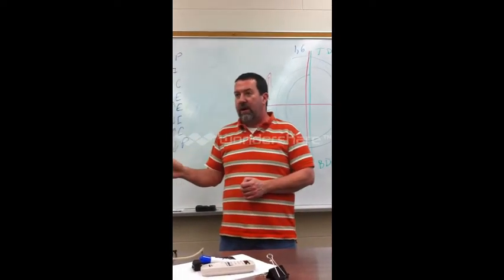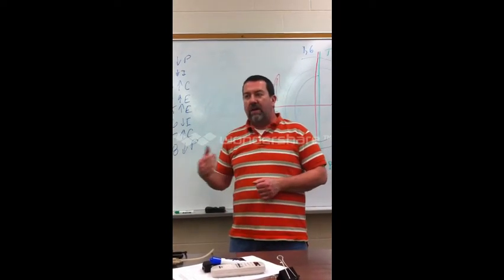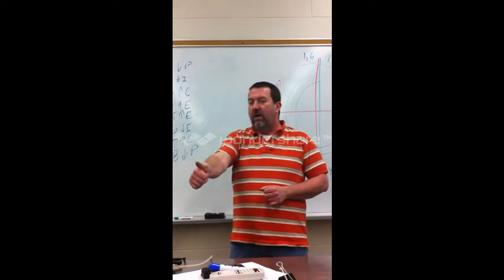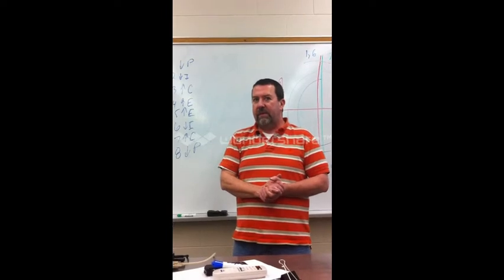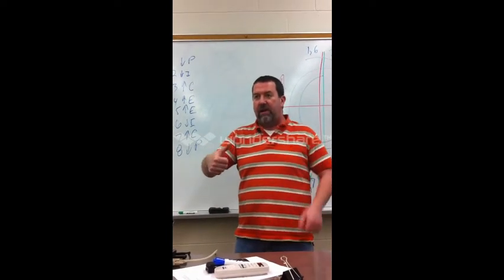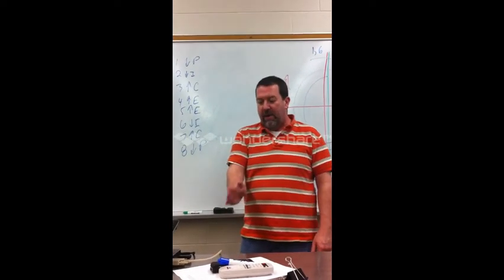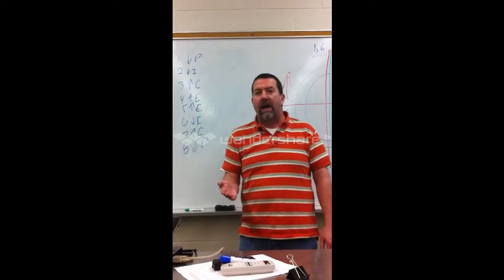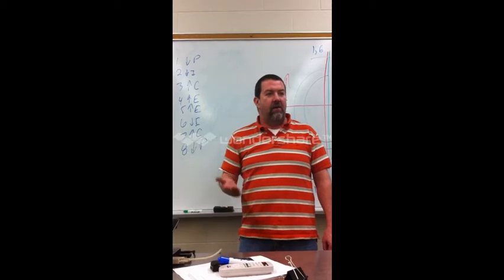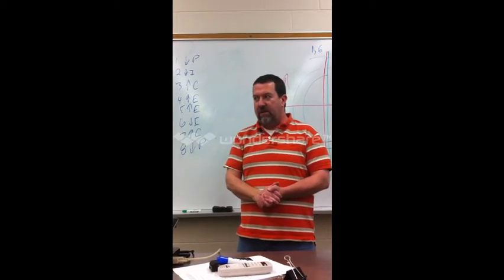One other way that you can do it is you can have someone crank the engine over for you, and you go to cylinder number one and you hold your thumb over the spark plug hole. What will you find? When it's coming up ready to fire, it's coming up on compression, right? So you hold your thumb there till you feel the pressure on it, and then you look down at the harmonic balancer and bring it until number one lines up. Now we know that we're at top dead center, ready to fire number one, I can drop the distributor in. Does that make sense for everyone?